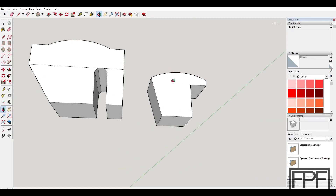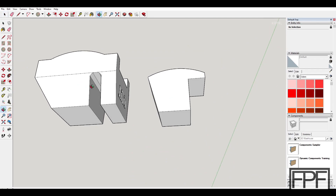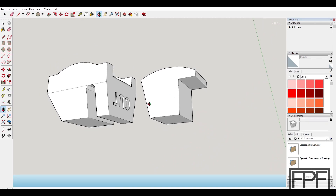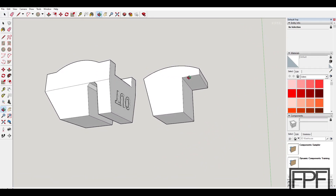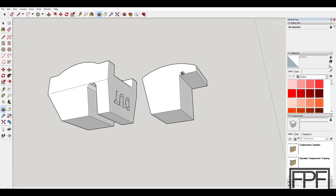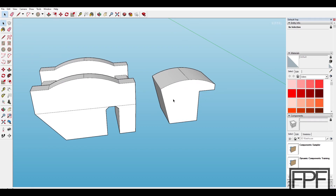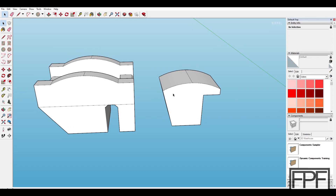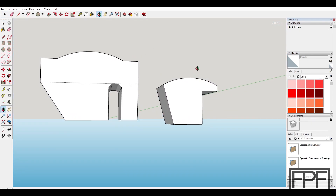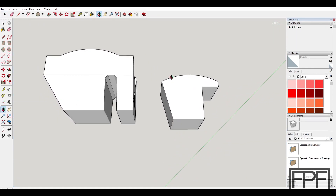You are going to need to turn on supports to support the curved section, so you get a really nice surface finish on that curve with no distortion, so it follows the curve of the jack nicely. I printed this at 0.1 millimeter layer height — both pieces actually. The TPU part's print settings are not that critical, but on the PLA piece, since we are carrying weight, I would strongly recommend printing at 0.1 millimeter layer height and not printing it too fast. You really want good layer adhesion — it should be more or less one solid block of plastic on the outside where the perimeters are, with 85% infill well bonded so it doesn't deform under the load from the vehicle.